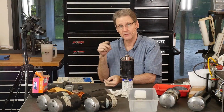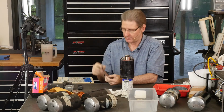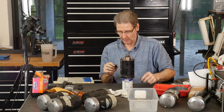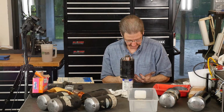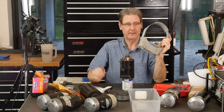Meanwhile, the torsion spring, that's the nice thing, these are constant force, right? The coil springs in the old 65A, as the brush wears down, get less and less force. These, because they're curlicue type, keep a constant force. Now, are they identical? Yes, they are. Do they both look in good shape? Yes.